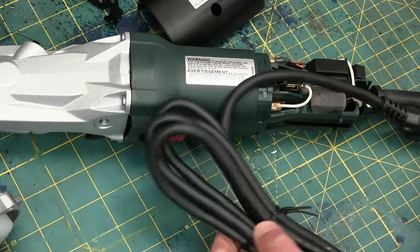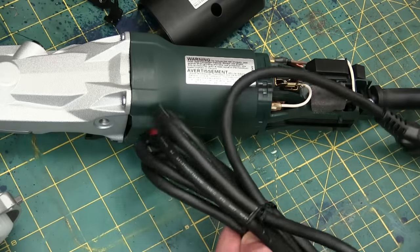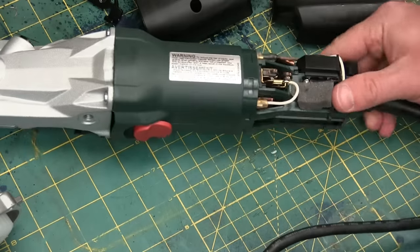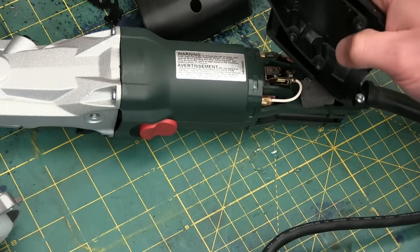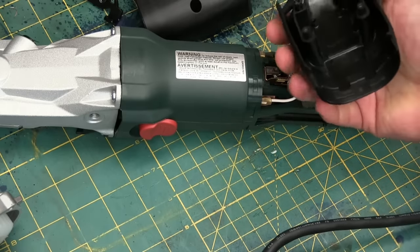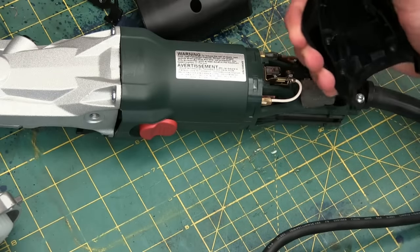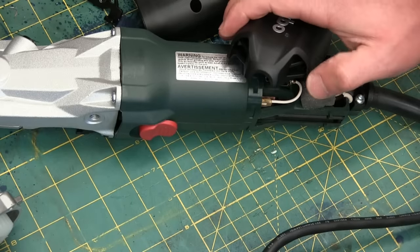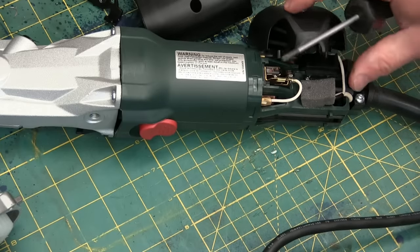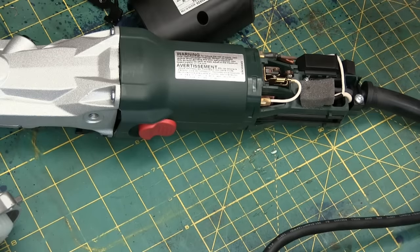Just into the backside of it, and already some surprises — some good, some nasty. This glass fiber-reinforced PA-6 — nylon — is nice and stiff because it's thick. They haven't chintzed out on the material. That is beefy. And I like this feature where the slots for cooling are actually recessed and shielded — you have a hard time breaking those guards. That's a smart feature.